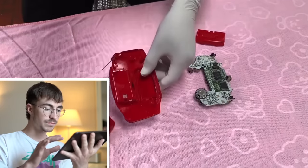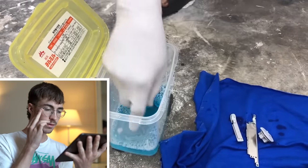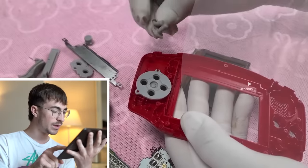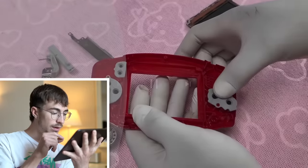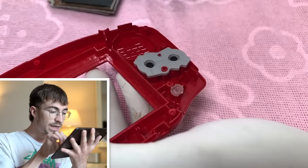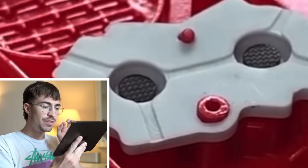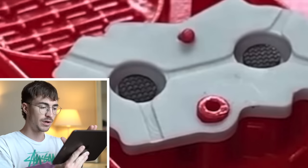We've got the shell, the motherboard, the screen, and the buttons — and those buttons are looking like completely different buttons. Do you remember those really stained brown pieces of plastic before? They're now brand new, as if they've come from a donor somewhere. Look very closely at the underside of that rubber membrane — do you see that crosshatch pattern? That is the indication that this membrane is aftermarket, because they never came like that officially from Nintendo. That is 100% not the one that came off this Game Boy.